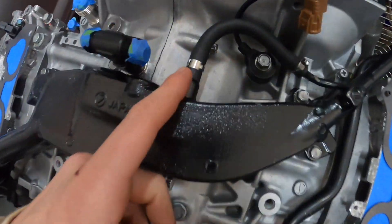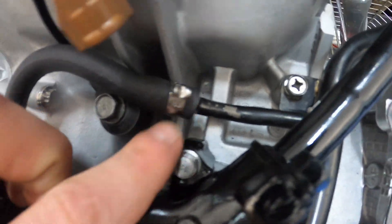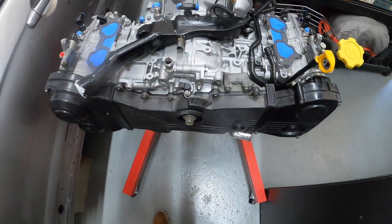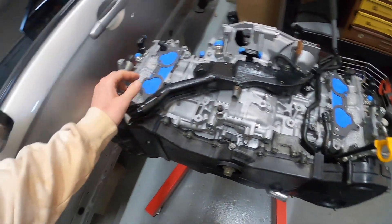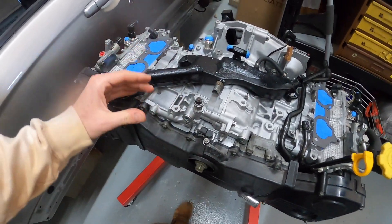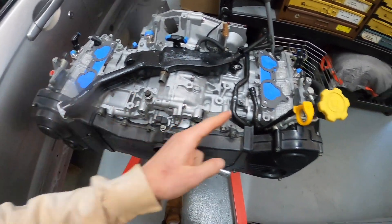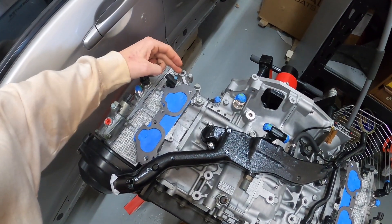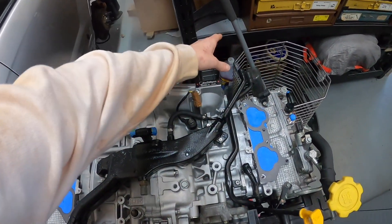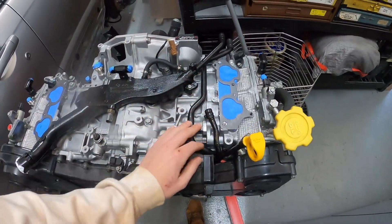There's going to have to be another 90-degree AN fitting and then the line going across for both sides - that's something I've been working on. I got these nice clamps - basically like a hose clamp but not meant to ever come back off, so they crimp the hose really well. That was originally for where the throttle body would be heated by coolant for wintertime startups. My plan for the fuel system is a parallel setup: 8AN fuel line coming in straight to the center, a Y in the center with parallel lines going out to each front of the fuel rail, then coming off the back of the fuel rail with a 90-degree AN fitting back to the center to a T, with parallel lines from each side going to the regulator, then through the ethanol sensor with a 6AN return line.